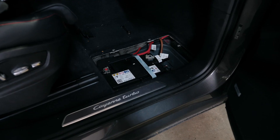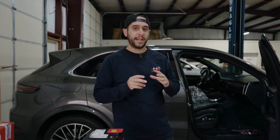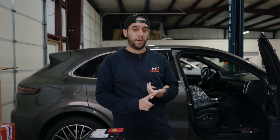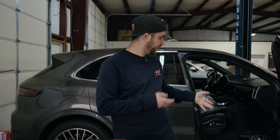Hey guys, welcome back to HBI Auto. This is Evan. Today I'm going over the lithium batteries on the Cayennes and some of the 911s. What we've had is a huge run on these lithium batteries where they're dying, and when they die the car goes into protection mode and locks everything down. The battery will not accept a charge. You can jump it from the post inside, but you're going to get an electrical warning on the dash — suspension will be riding super rough. The biggest thing is the batteries are two thousand dollars from Porsche, and right now they're on back order for about a month and a half.